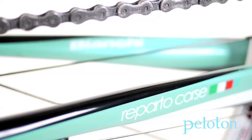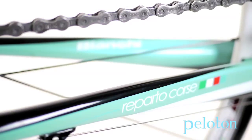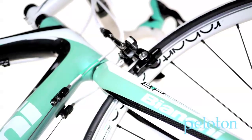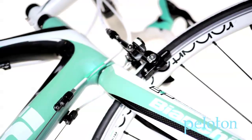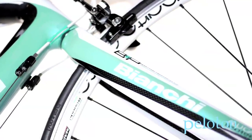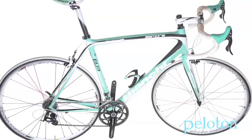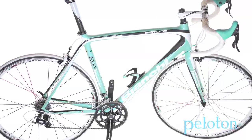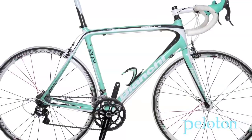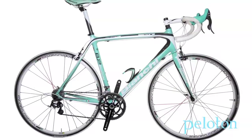The use of nanotech — small particles that fill voids in the carbon — helps create enormous stiffness and strength out of these slender tubes. The steer tube is one of the few places the budget price point of the bike is revealed. The Campagnolo Veloce spec gets aluminum, mated to straight carbon blades. If you opt for the frameset alone or the Ultegra build, the fork is full carbon. Weight for our 59 centimeter Veloce build was a beefy 19 and a half pounds with pedals and a bottle cage. The cost: $3,149.